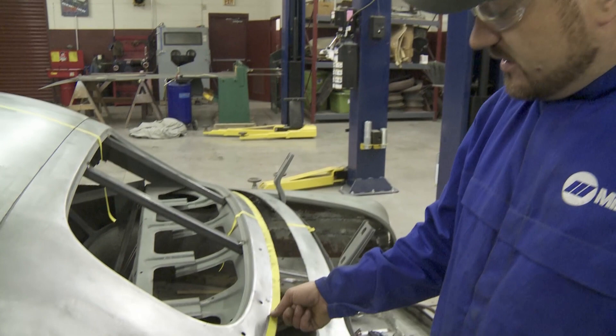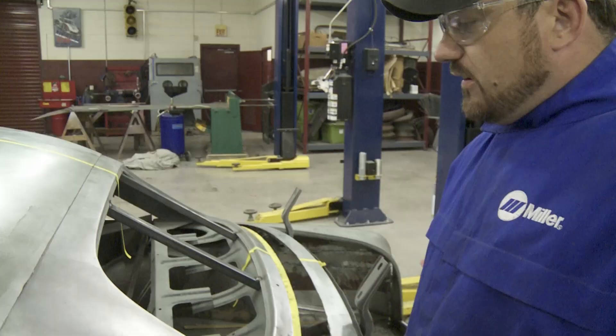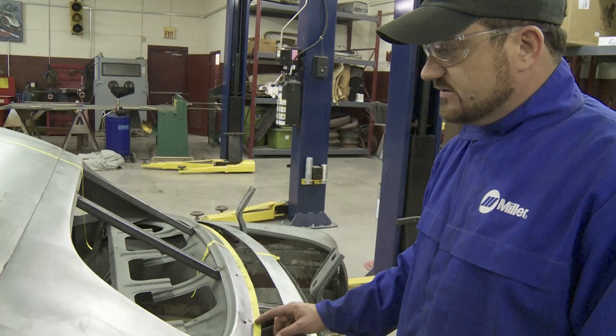You can see we cut this loose, and now we're folding the rear window down to get it in the right plane. We got the window loose and tucked it up underneath the top. We want to get a nice little contour as it just flows right on back to the rear, and that's where we're sizing up right now. Later on we're going to have to come in here and add our little filler piece, which will be handy that we left our three-quarter inch flange.